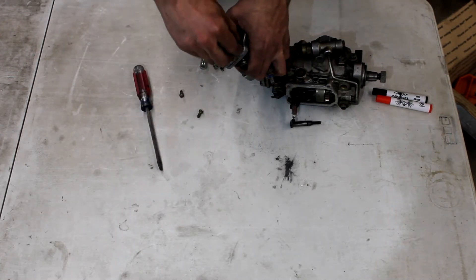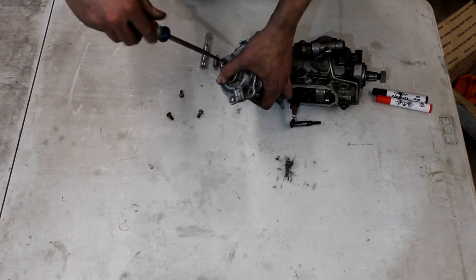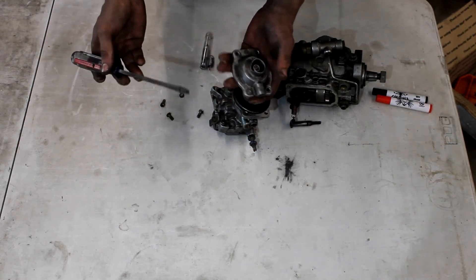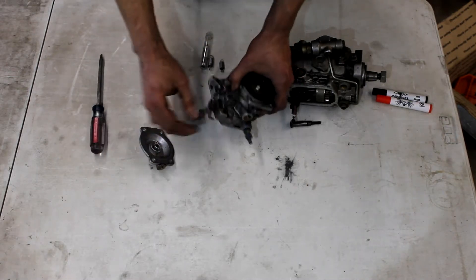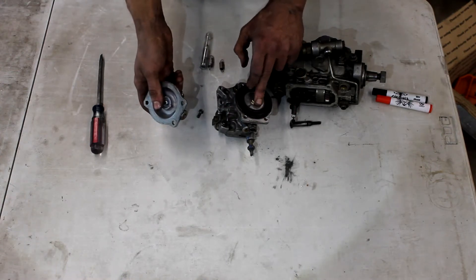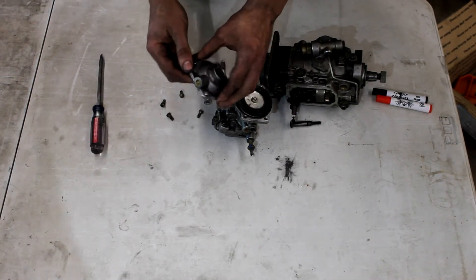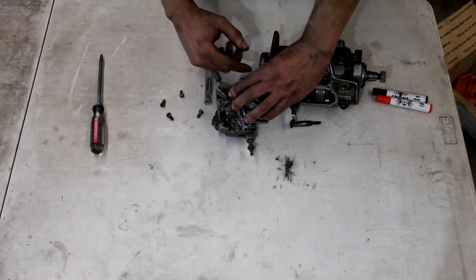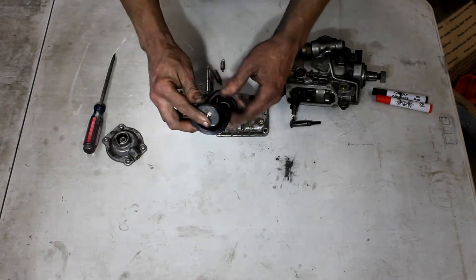The cool part about the AFC top is it can go either direction once you start modifying your throttle linkage and feeds. This will have a tamper-proof cover on it - use a small screwdriver, hammer it down in there, or hammer it through the middle and pop it. This also has a tamper-proof cover - just grab it with a pair of channel locks and wiggle it off. As we can see, the bottom of this pushes on top of the diaphragm and controls how far down the diaphragm sits, which connects to our fuel pin.